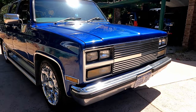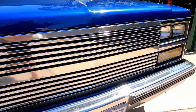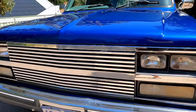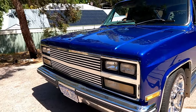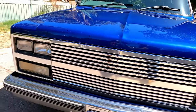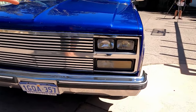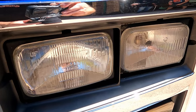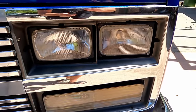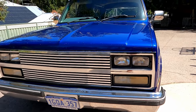So is that the standard grille? No, that is not. Probably one of those early 90s mods that screams out — the original grille is a plastic one. They changed nearly every year they released the square body, which has been around from '73 to '87, so pretty much most of those years had a different grille. You can actually buy all these square body parts quite easily from the US. One thing to point out — a lot of people think these headlights are like the 80 Series ones, but they're actually smaller, a weird shape that only a handful of cars ever came with even in the States. They run H4s but are still very small, and the lenses are a left-hand drive configuration — unobtainium now.